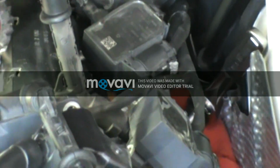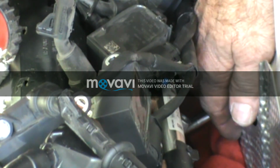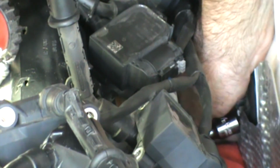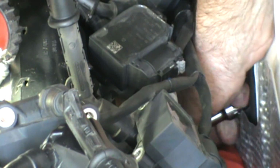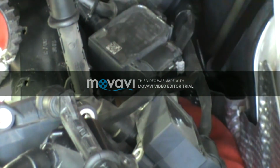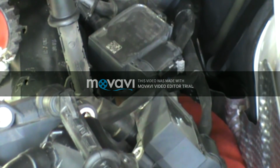Here we go. I'll take the swivel off first, and then that should pull on out. Okay, there was not quite enough room to get the extension and socket and plug out, so I'm going to undo the lock on my extension. I think I might be able to get this a little easier with my finger on it. There we go. Okay, got that off. Now, because that's kind of tight down in there, I'll just use my magnet. Here we go. With the right spark plug wrench, it holds the plug on there real nice.